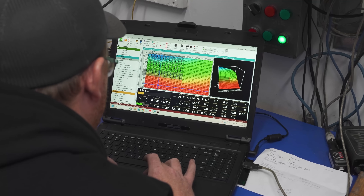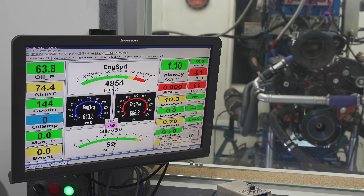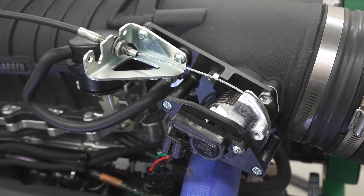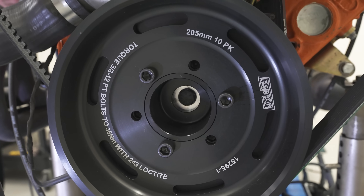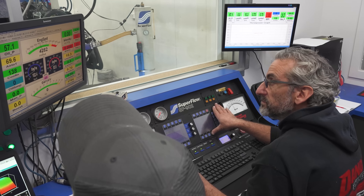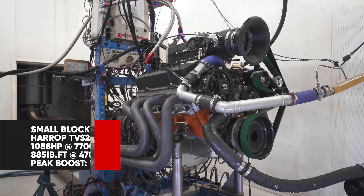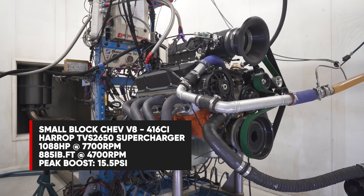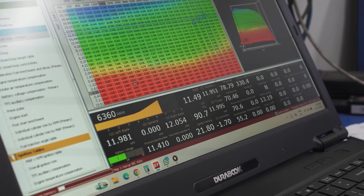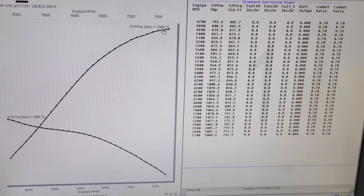Supported by Nads from Fuel Tech, who as always does a great job looking after the engine management, the combo is also running the integrated 110 throttle — available in both drive-by-wire or cable actuation — and the 205mm lower crank pulley. Starting with the 85mm supercharger pulley on E85 pump fuel, peak boost was 15.5 psi and power was 1088 horsepower at 7700 rpm with 885 foot-pounds of torque at 4700 rpm.